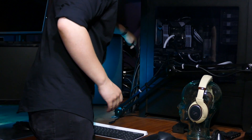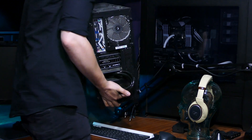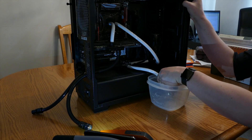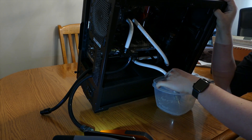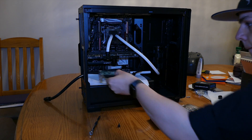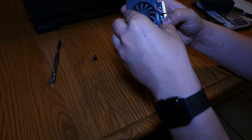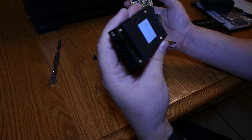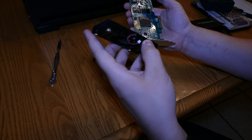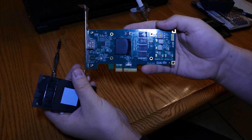I started by turning off both my PCs, powering down the full room loop, disconnecting the recording PC from all its cables and the loop itself to move it into a different room. The next step was to drain the loop so I could introduce the new water block and resequence some of the tubing. After removing the card, I began to disassemble its cooler. The best way I found to do this was just pinch these clips on the back with some tweezers. After successfully removing the cooler, I noticed the cooler was full metal, so I shouldn't have to cover the board with those pads I bought to protect it from shorting out — putting the water block over the chips should be no different.